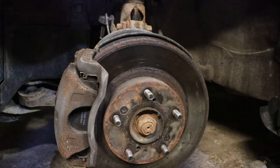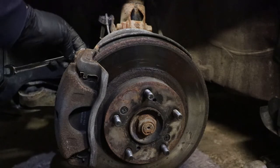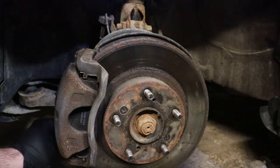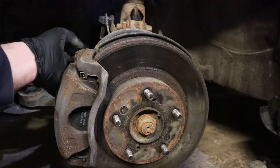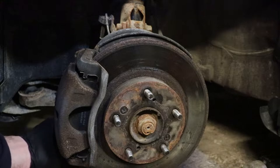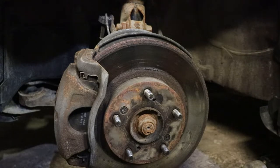The caliper bolts are 12mm. The reason this vehicle makes noise when driving is there are ridges of rust on the rotor. If you're really desperate you could use a grinder or a hammer to chip off the rust on the edges — I did that last year but it didn't last very long. So I'm going to replace the rotors now because you can see the pads are actually pretty new. We'll take the calipers off and the adapters. I'm going to stop the video and get a C-clamp out so I can fully compress the caliper.